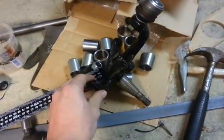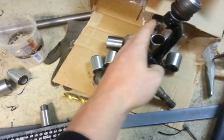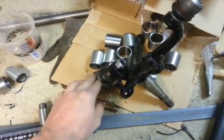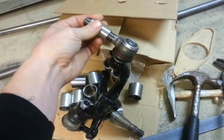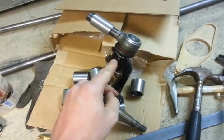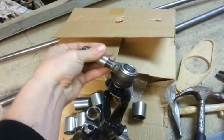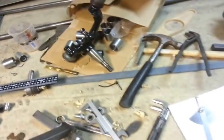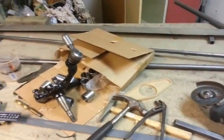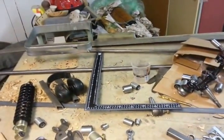For the front, I am using Volvo spindles — the classic ones. I have bought new joints everywhere. I am still waiting for some rings I need to have around here — I will show them when they arrive. The upper end is done; I need to reshape it inside here because it's the wrong angle. But those parts are done at least, and I can move them around as I want. I also bought the special type of tubing for that, and I have the certification paper for the strength of the tubing as well.